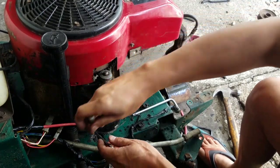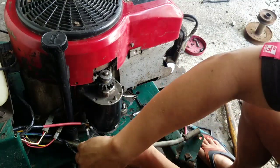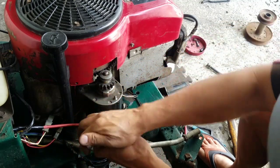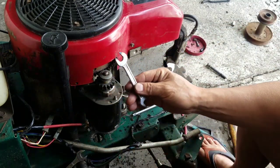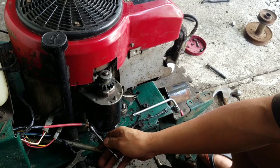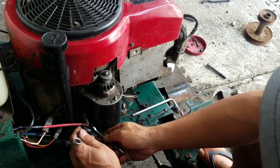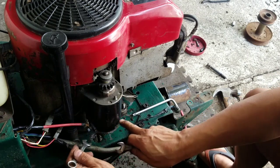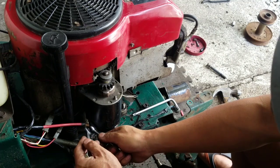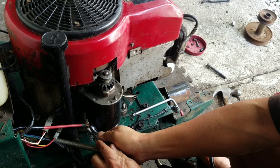To make sure you don't strip that inner wire circuit again, which is a major problem with this, because you have to get a ground down 7/16 thing so it's nice and sharp, because most wrenches won't fit in this area. So you're turning and turning and then you're twisting it and you'll pull the wires right out of the circuit, which is why a lot of people mess up their starters. As a matter of fact, the one that we just pulled off of here, looks like that was it. That was the reason.